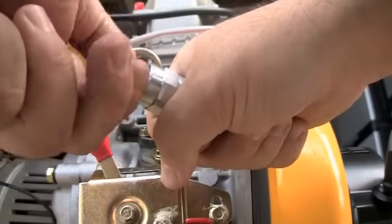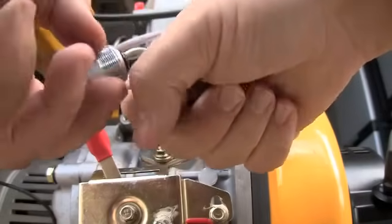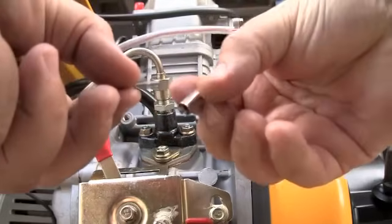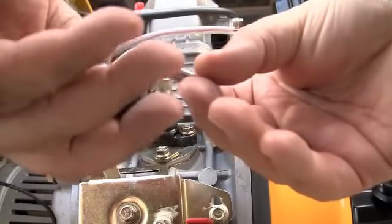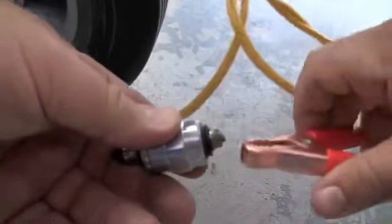I'm going to test it here — pretend it was installed in a fuel pump. You could always remove it and take the plunger out to disable it, and it'll never block the fuel passageway going to your pump. If you ever want to turn off your generator, you'd then have to use the run/stop lever instead of the key switch on the front of the generator.